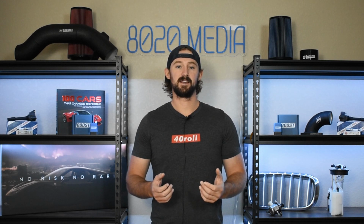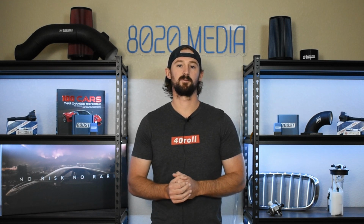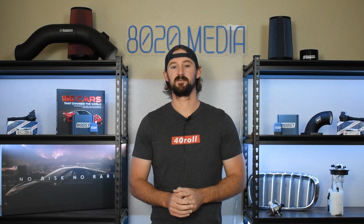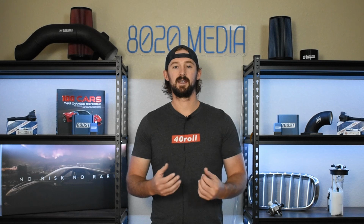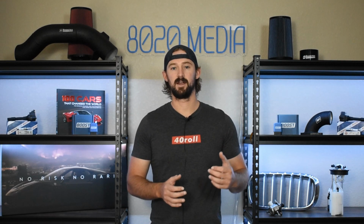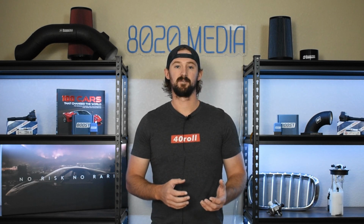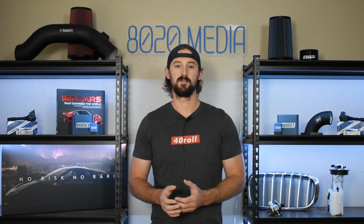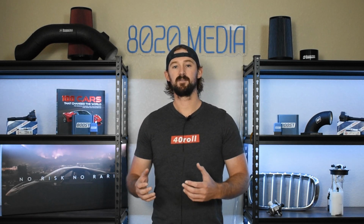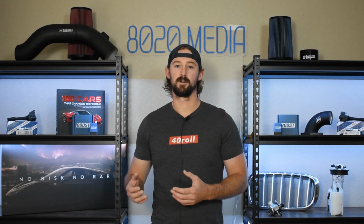The BRZ has a very good fueling system from the factory and is 100% flex fuel capable, meaning you can run full E85 and reap the benefits of ethanol fueling. Now, ethanol fueling, or E85 specifically, has an octane rating of 100 to 105, depending on the ultimate ethanol content of the gas. And so when we compare that to the traditional 85 to 93 octane that you get from traditional pump gas, we have a significantly higher octane rating, which is a lot better for power and performance.